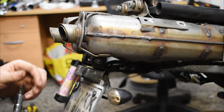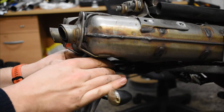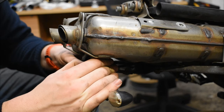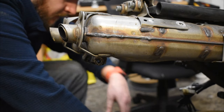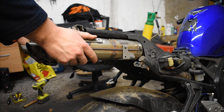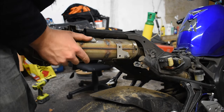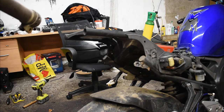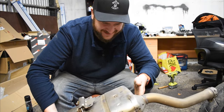Remove the two small bolts holding the registration plate lower frame — don't worry about that frame because you get a new one with the kit anyway, and it's way prettier. Also, don't bash your hands on the tire like I did. Pull back on the exhaust and give it a good wiggle and it should pop right out. The standard exhaust is hideous and ridiculously heavy, so very happy to have it off.